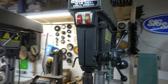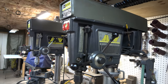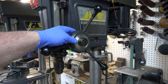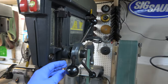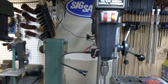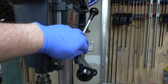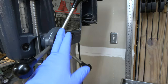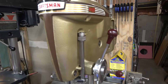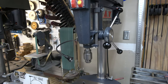Additionally, the commercial models use a different size spring — it's actually one inch longer, which required a longer pinion. So the pinion protrudes through the hub rather than stopping inside the hub, hence that black knob on the center of the hub. Notice on a Gen 4 standard model, that's not there. And that hub is basically the same kind of hub that's on the previous King Sealy and Emerson Gen 1s.